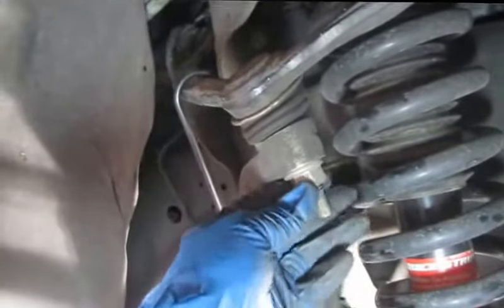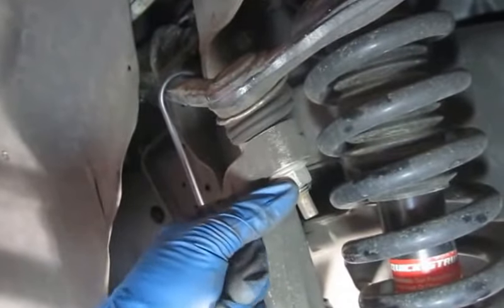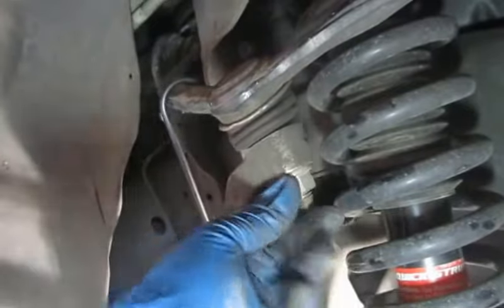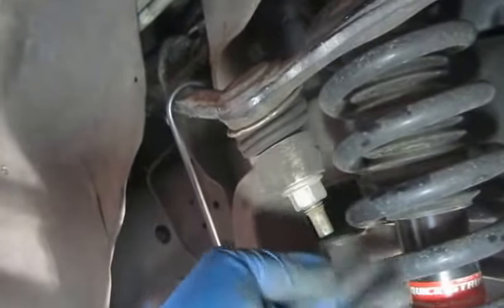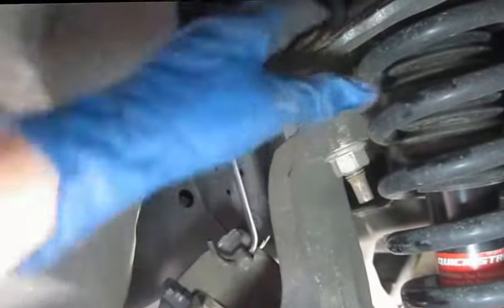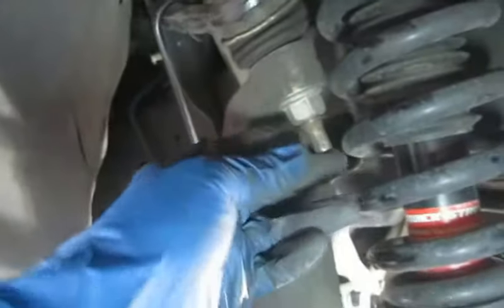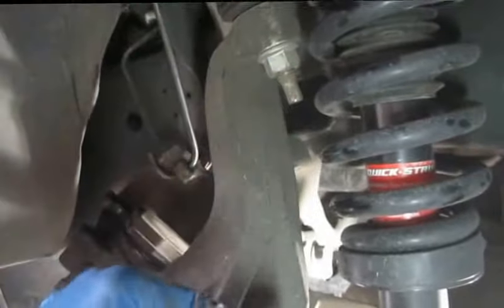So anyway, I'm going to take off this guy. I may have to drive this up a little bit. You don't want to damage all this stuff so you have to be really careful. One way to do that — it's a little tricky with this kind of nut — but you might be able to turn the nut upside down and put it back on there enough to beat on it as opposed to beating directly on the stud. Or you might even be able to tap it out. If by chance you start taking these off and the whole thing wants to turn on you, that's what these little hexagons on top are for — you can put a wrench on that and hold it while you loosen the nut.